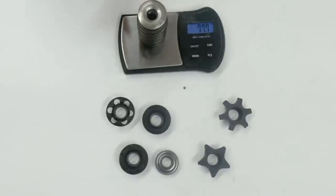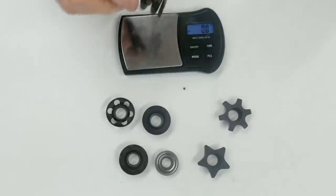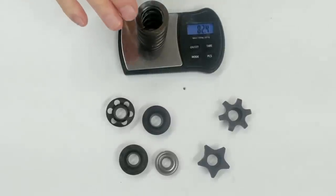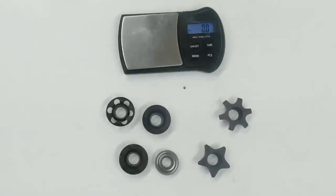And because it's got such a high resonant frequency, just before the end of its lift, it's over 100,000 cycles per minute. That is super high. You can't get that out of a spring like this, right? About the highest you can get a decent parallel spring like this is around about 32,000 cycles a minute. That's it. So now you can see why the beehive spring, ultimately, if the price is right, would be our choice.